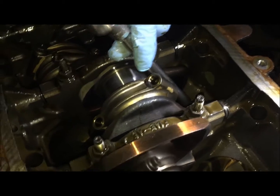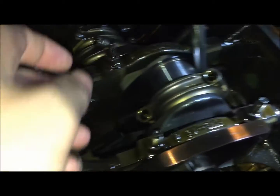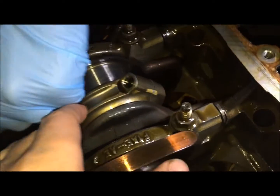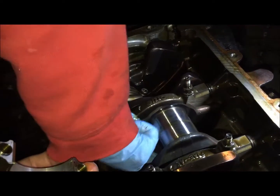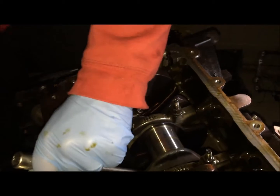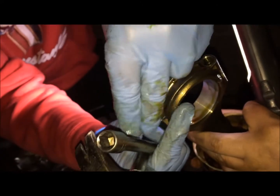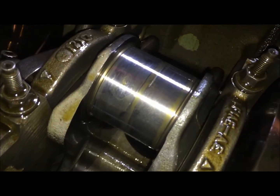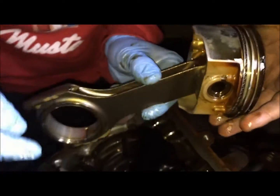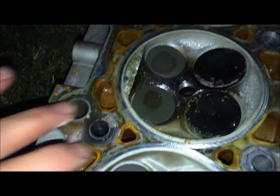Gently tap it. So here's the side — just pull it straight out. You will have to tap these ones out and we'll look at them too. So we'll reconnect number three. The SVT logo is towards the front of the engine, facing the front. So that's all number seven here — chewed up pretty good valves. That one's definitely going to need some rebuild. The other ones look pretty good.